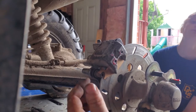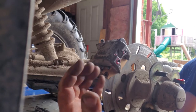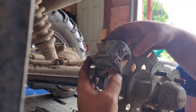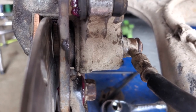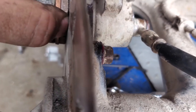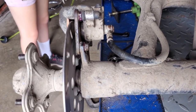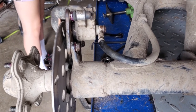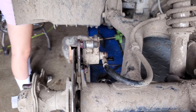All tightened up and ready to go. You can see this pin looks like it's right at the very edge, but once we pump the brakes a few times and the piston closes back up, it's going to come forward and it'll all work out. You can see there the piston is beginning to move and the brakes are now touching. She's rotating quite nicely, no problem - helper is going to hold the brake down. That's working perfect. And that is how you do the back brakes.